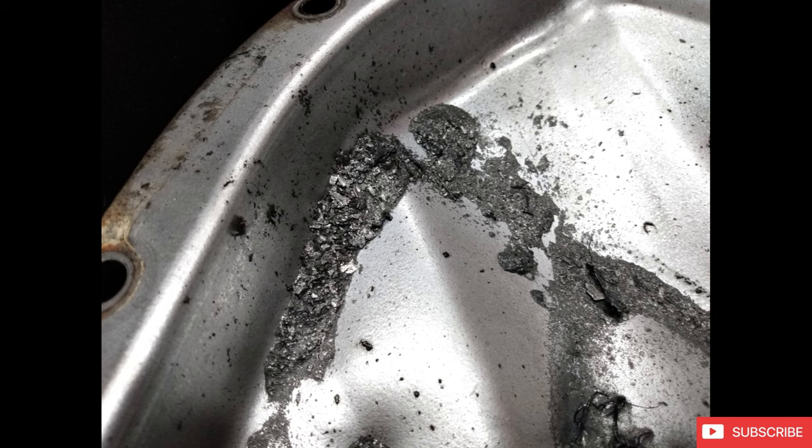But luckily, there are a lot of aftermarket applications. You can also use a Holley 302-1 pan. That's a really nice solution. You can get the Holley one, or you can get a knockoff. They're both pretty good options depending on your price point. But you definitely want a rear sump pan, and that'll put you where you need to be as far as oil pan clearance. So once you get your oil pan and motor mounts installed, make your modification to the crossmember.